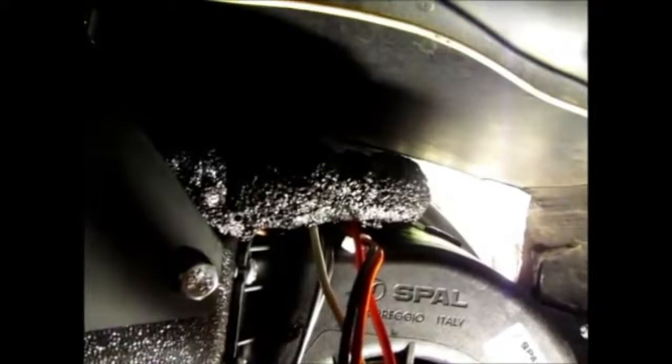Now, the hose actually runs, let's see, you can see the hose, the way it runs, how it goes into the unit, the air conditioning hose. And then there's this black sticky thing, it's called press tape, that you have to put onto the fittings, I guess for sweat or whatever, so it's supposed to prevent these fittings from accumulating condensation and dripping. So we got that all nicely press taped. And then I'm gonna tighten up these bolts on there. I already tightened up the one in the firewall, and I'll have to see about routing my hoses.